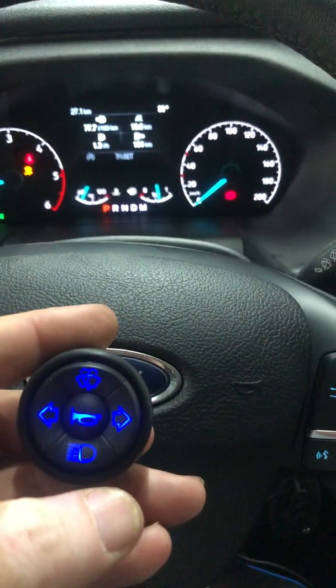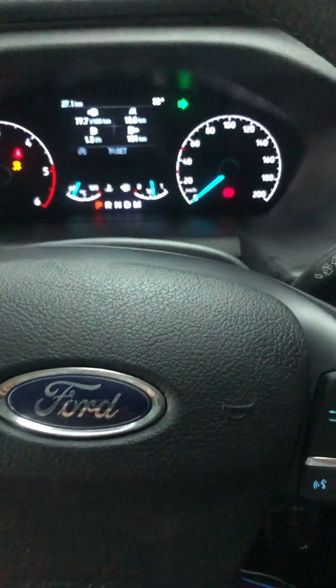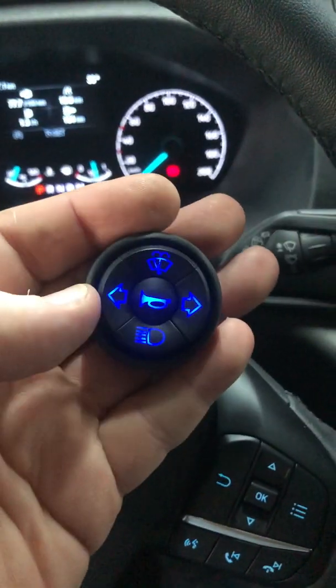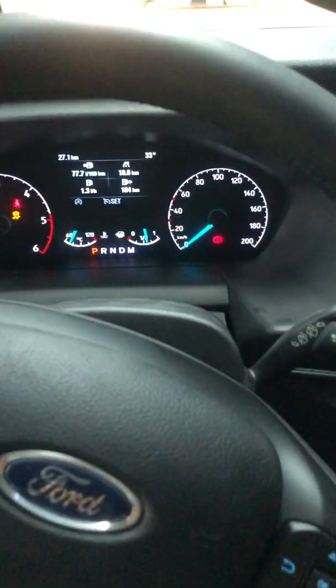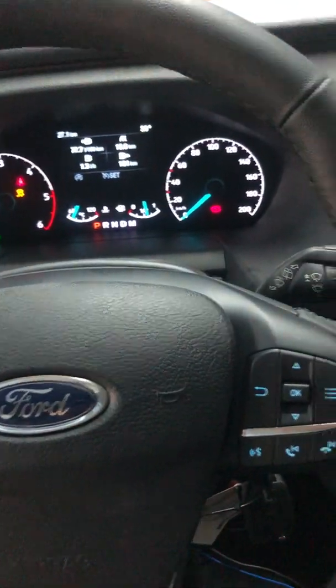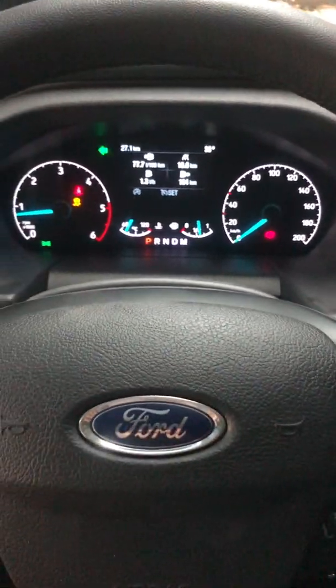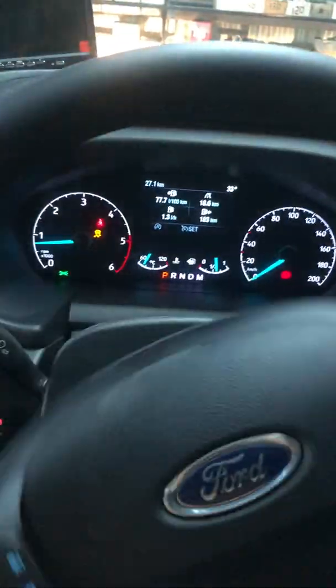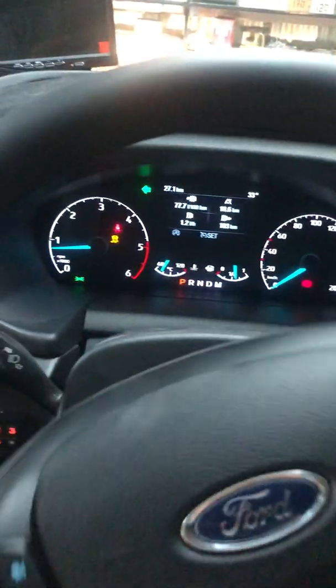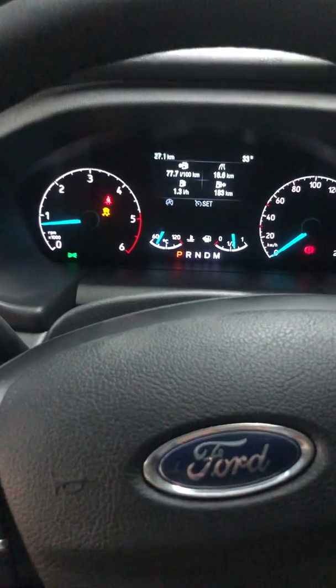Now also for the turn signal, for example here I can indicate right, and I can cancel it by the steering position. I can do the same for indicate left. I'm going to show one more slightly complex function. If I indicate left and rotate the steering all the way right, like going into a roundabout, same thing here. Now the steering is straight, and it cancels only on return of the steering.